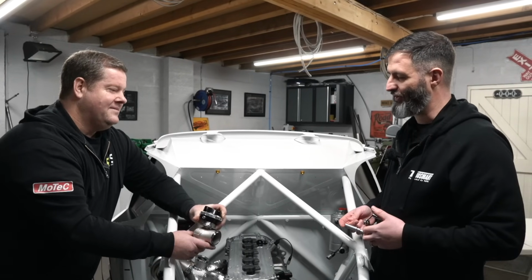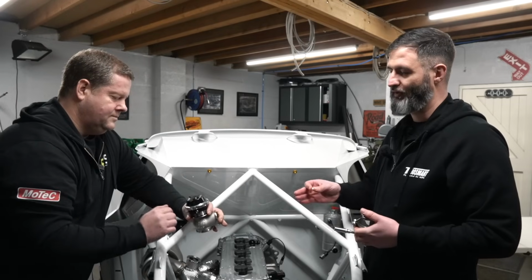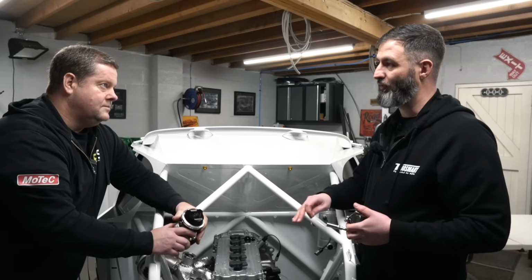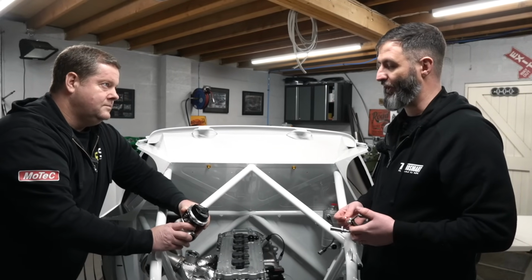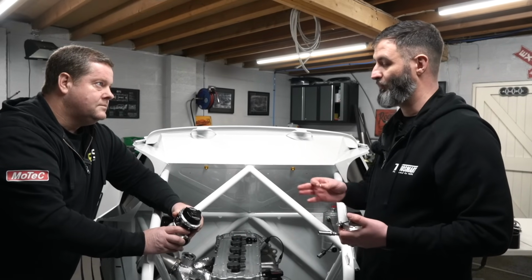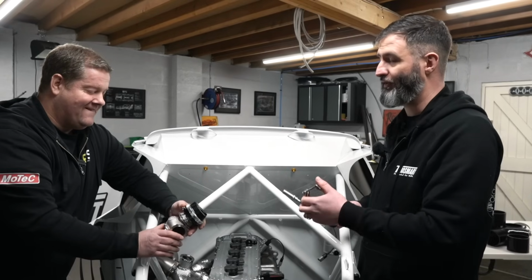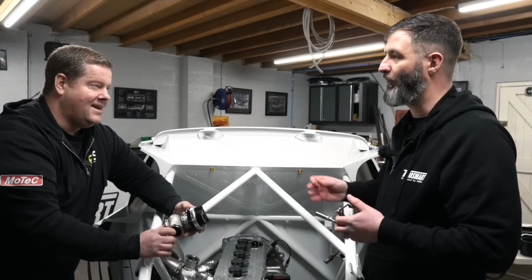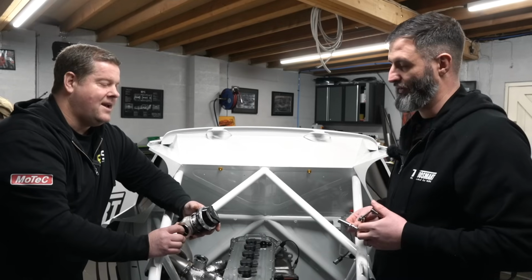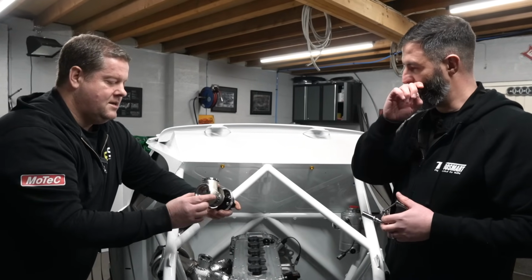Yeah, well, this is one of the uniques about TurboSmart and how we test, why we say engineered to win. So we test at EGTs of 1300 degrees. Without water cooling, we can use a gate at 1300 degrees for up to 45 minutes. With water cooling for 24 hours. Yeah, it just makes a huge difference. That's 1300 EGT, so miles beyond where cars will get to. But we like to test above and beyond. And definitely on that next level.